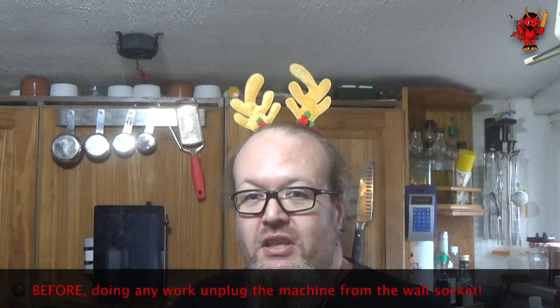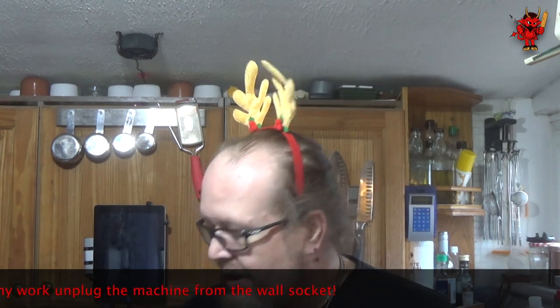I'm not a dishwasher engineer, but I'm making an attempt to fix this. The main way to repair it would be to strip it all down, take the sump off and put a new one on, but that's a lot of work. I've managed to find a replacement seal kit available directly from Bosch's website — the code for it will be in the description. I bought mine from an online UK company that sells both the Bosch kit and what seems to be a third-party kit, slightly cheaper. I'll show you how to do this repair with this seal kit.